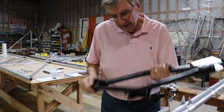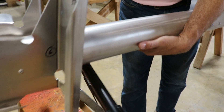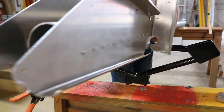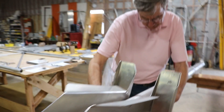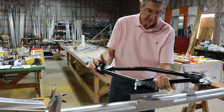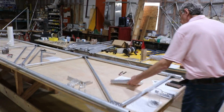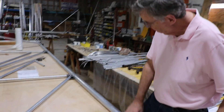The butterfly cabane is actually attached to the seat pan first — it's bolted on. The holes are pre-drilled and you're matching the holes. You may have to ream the holes out slightly to make all the bolts fit, but this is how it's installed. The butterfly cabane is the main structural member of the fuselage. It comes to you already pre-built, pre-painted, and all you're doing is attaching.